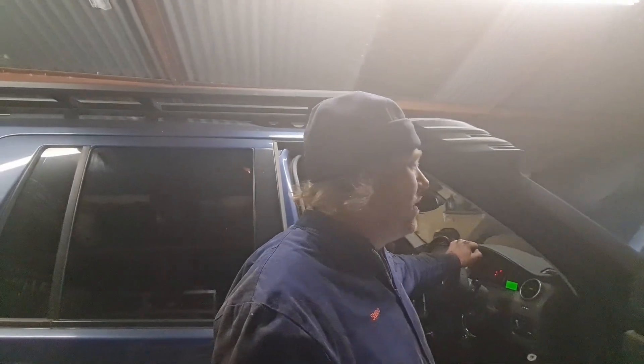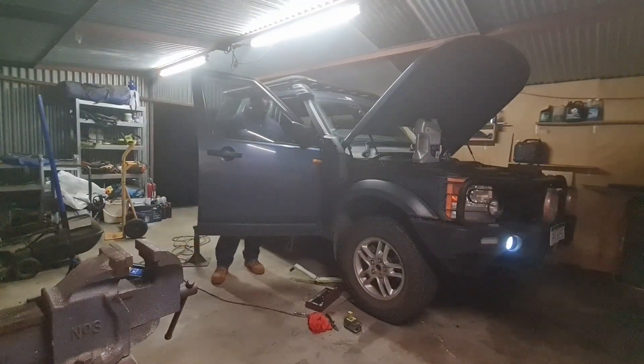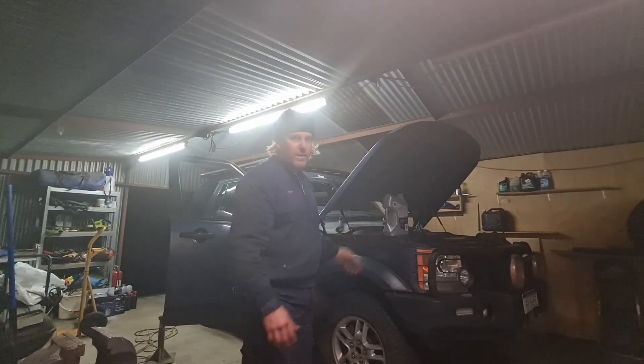This particular car can get a bit fiddly sometimes when you go to start it afterwards — you'll know pretty soon, it'll just stall and won't play the game. Let's see if she starts and starts running. Sometimes you just need to bleed a bit of air — there's a bleeder at the back of the engine, so it looks like that's what I'm going to have to do.